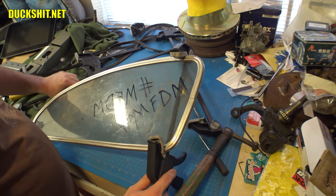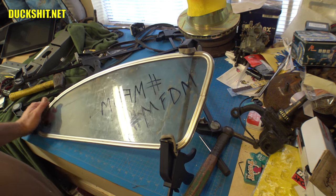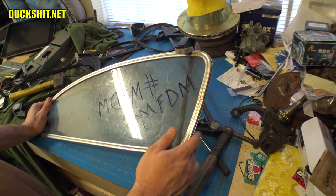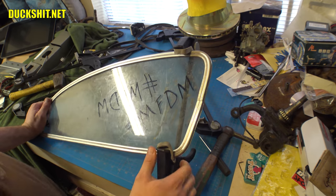If it's actually aluminum, I don't even know. I tried to cut it with the angle grinder earlier with a cutting disc on it, and this stuff just does not want to cut. Steel will throw sparks all over the place and cut like a mofo, but this stuff, whatever it is, it just got really, really hot. It didn't want to cut. I mean, it seemed like I was just holding the damn thing on it forever.